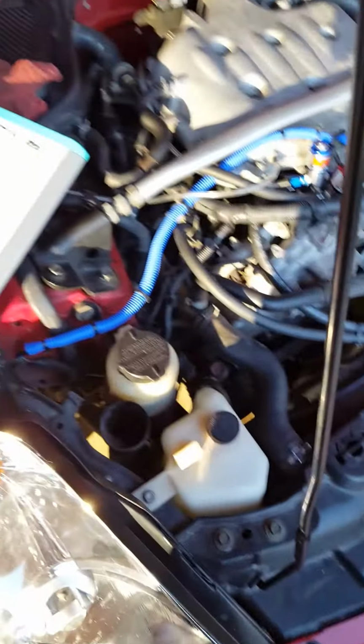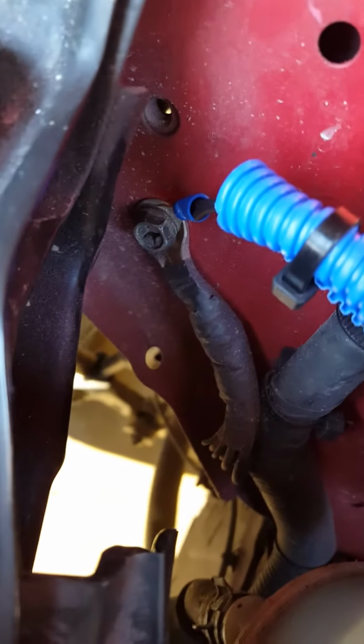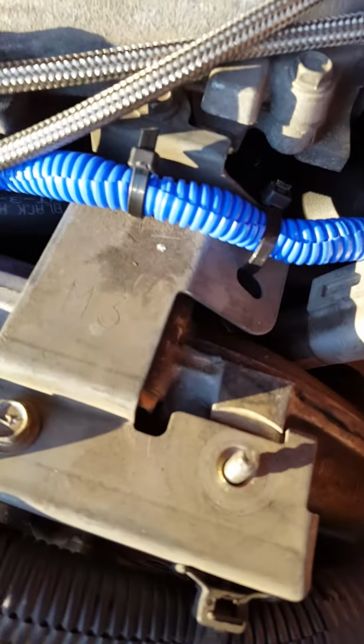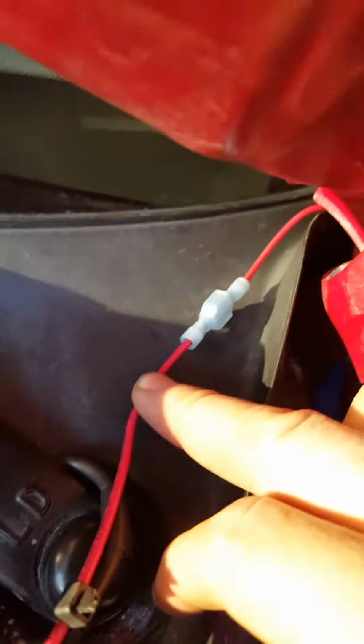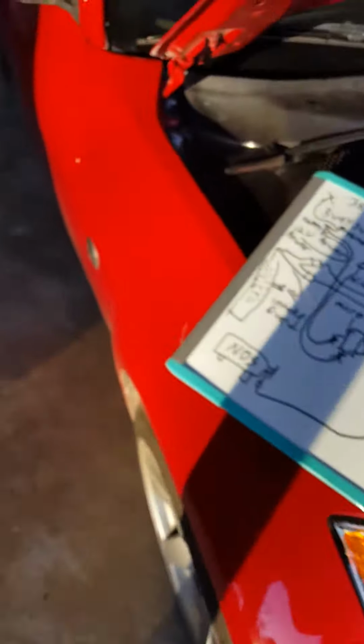But I always use a good pair of wire strippers, a good pair of wire crimps that crimps the plugs. Get you some ground wire crimp wire deals like that. Put the two wires in there, you crimp them down. And also, see if I can find it. Oh, where it's at. But okay, for instance, these. Those are the type of plugs you want to get. And get some good crimps. Crimp the wire in there. You won't have a problem. And I got these ran all through the car. I even did the same with my shift knob as well.